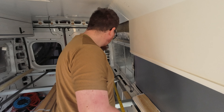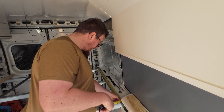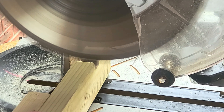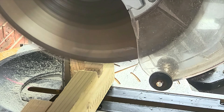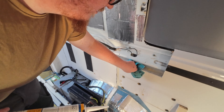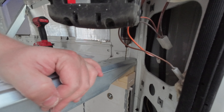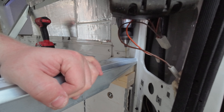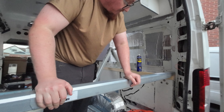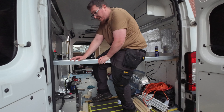Adding our beams to the bed was an easy enough process but it was also a bit technical. Stephen measured out the wood to fit over the pre-existing wall brackets of the van. He then marked the wood where the bolts in the brackets were placed and using his saw he was able to carve out notches in the wood beam for them to fit into place. When the wood was ready and cut to size he wiped down the surface and applied strong glue to the beam to keep the wood in place. After this he reinforced it by adding the Ikea Skorva beams we bought and screwing them into place. Just to make extra sure they were secure he decided to test how strong they were to make sure the bed wouldn't collapse under the weight of us both.